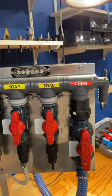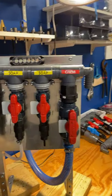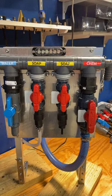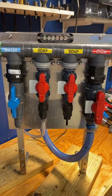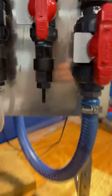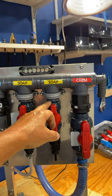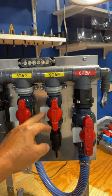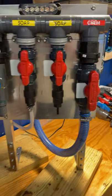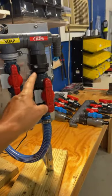This is the front side — I really like the way these tees come together. They got the True Blue on them. I put one on my trailer yesterday and I really like it. I just want to make sure we had no problems with them. The barb and the soap valve are always going to be quarter inch. You put a half inch to one inch, half inch reducer, put your half inch soap, then reduce down to a quarter inch barb.